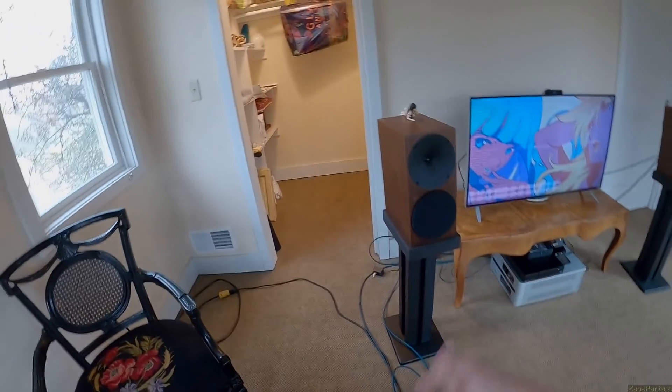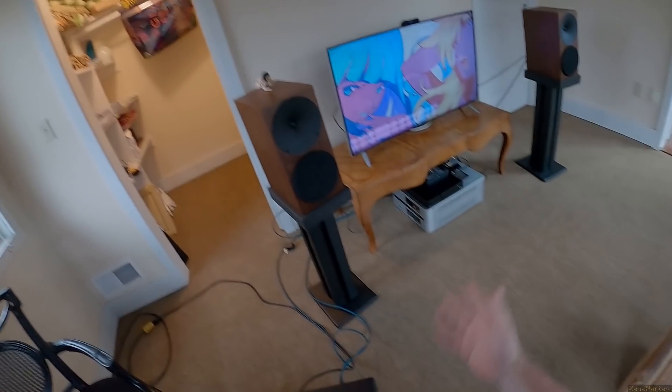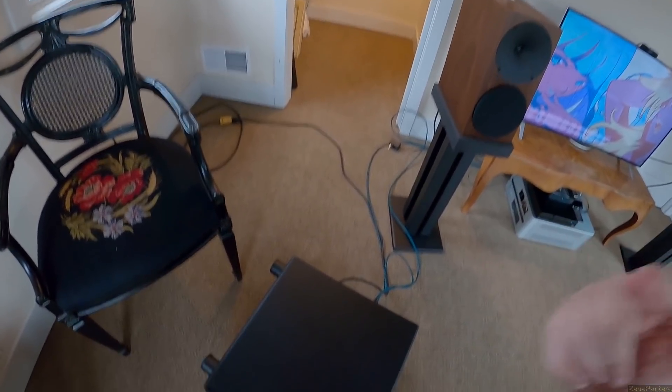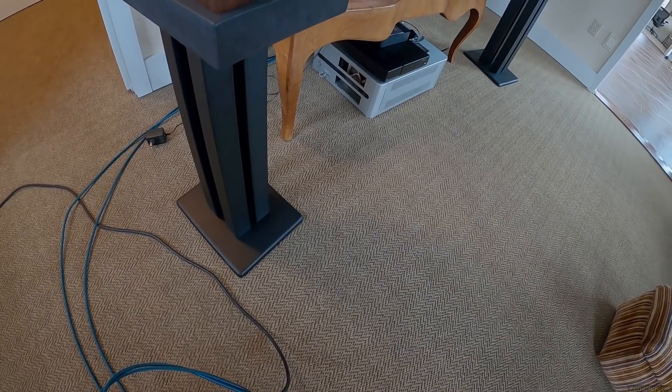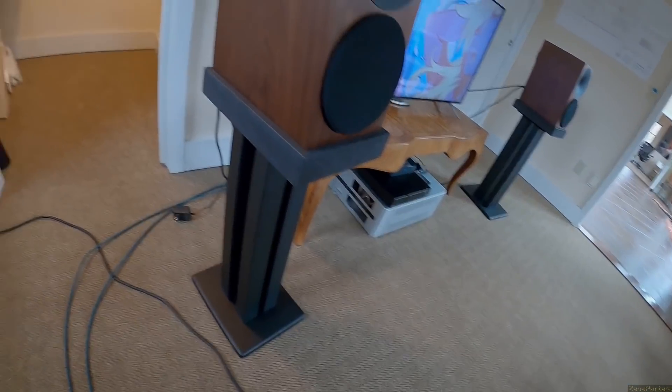The reason I got so excited about the S8 was these connections, because people always ask: 'I want to put a subwoofer on my desk, how do I do that?' This subwoofer is the answer to that. You have to understand how the signal path works. The RCA cables right now are coming from an SMSL VMV D1, which is my DAC. There are XLR cables going to each of the Buchardts, and then the RCA cables come to here, so the volume on the speakers is fixed.